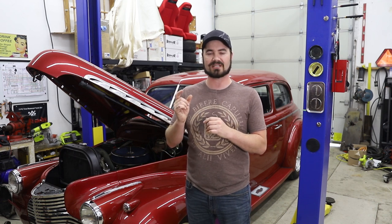In the previous video, you also saw why the logic is so important for building your relay trigger circuit to be grounding based. In this case, the toggle switch that existed under the dash already is used to ground the relay's triggering side to close the circuit. By doing this, you're future-proofing the system. All I have to do to complete this system is send a grounding signal from a thermo switch, and I can make the system engage on its own by tapping into the same wire the switch closes. If you were to use a fuel injection system like a Sniper EFI on this system, the computer would also be sending out a grounding signal, so it gives you future-proofing should you step up to a fuel injection system or if you want to keep using basic thermo switches.